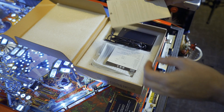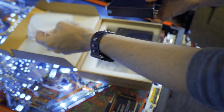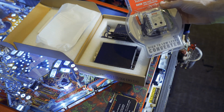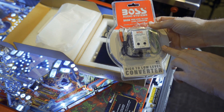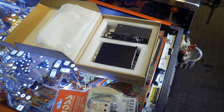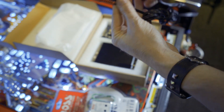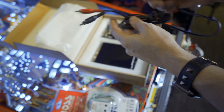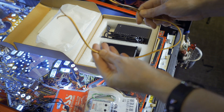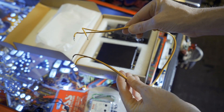We've got a 100 watt little micro amp. In addition to this amplifier, you're going to need three other things. First is a high level to low level converter — this takes your speaker outputs and turns it into RCA line level. You'll need that and a short RCA cable to go from the converter to the amplifier. Any length will do, but about a foot long keeps it neat in the game. The last thing you'll need is about a foot and a half of speaker cable — standard gauge like you'd use for a car stereo or home stereo. And that is all that you need.